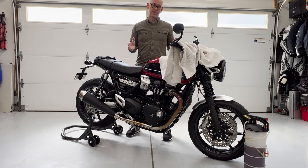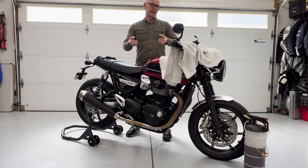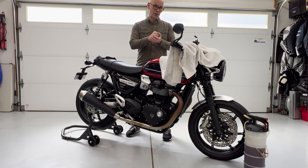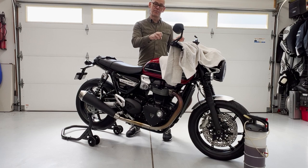The reason you need to do this is that brake fluid is hygroscopic, meaning it absorbs water. That's a problem because once your brake system heats up, that water has a very low boiling point relative to brake fluid. It causes vapor, and the vapor is compressible, which you don't want. So you lose not only brake feel but braking power as well.